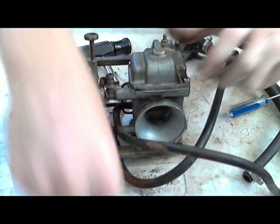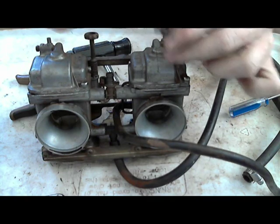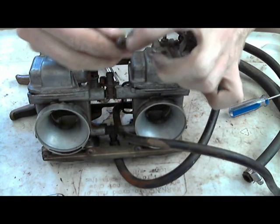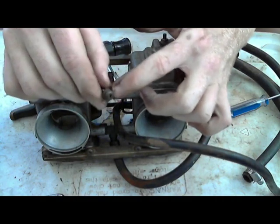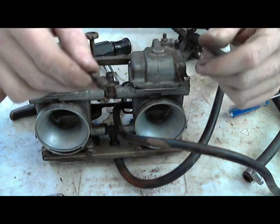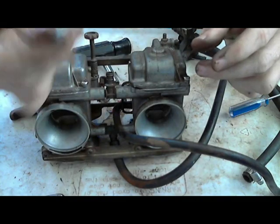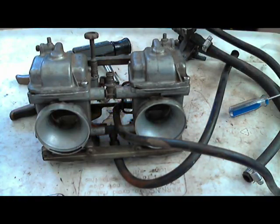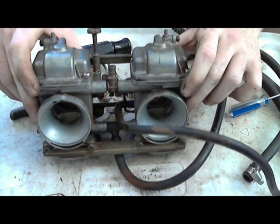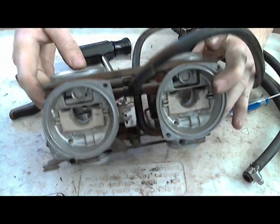then what I've done before is take a drill bit, match it up to the size of these threads, and start drilling from this side until I get down to the bottom of the head. Then you take a fatter drill bit and snap the head right off, and you just get replacement screws. That's a last resort if you can't get the screw out. So that's this side.